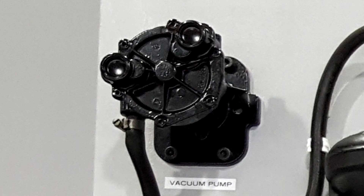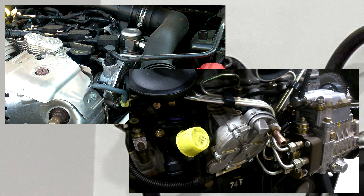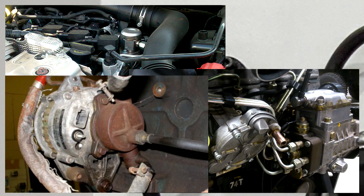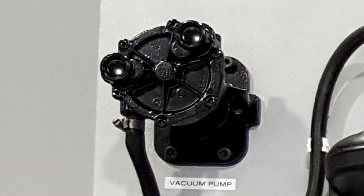What we need to do is fit a vacuum pump somewhere. Some engines have a direct drive engine pump which can be off a camshaft. Some have a belt driven pump or even mount them to the back of the alternator. And some can have electrically driven vacuum pumps which can be positioned pretty much anywhere. In any case, it doesn't really matter where your vacuum pump is driven from, only that you do have something that can create the vacuum.